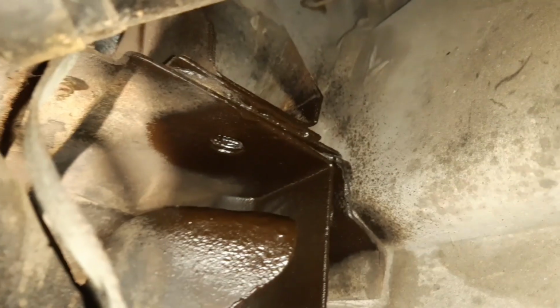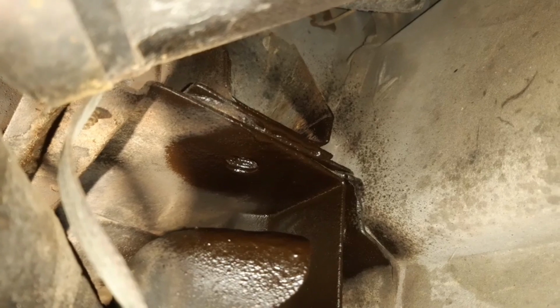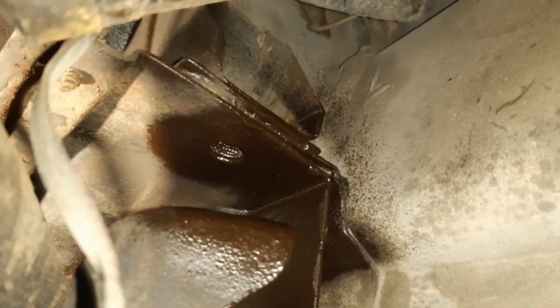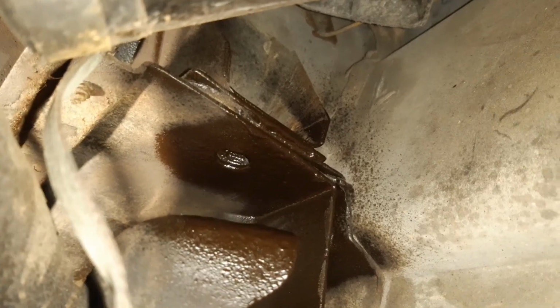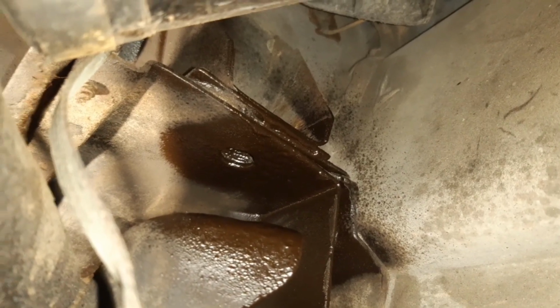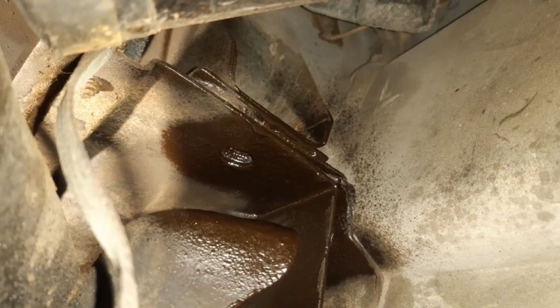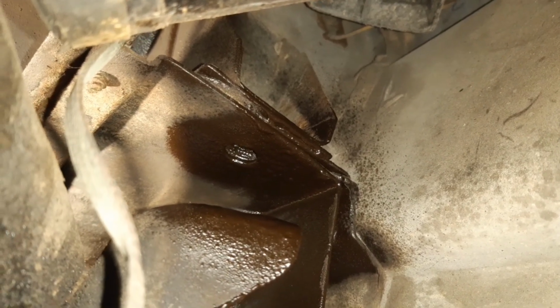And again, just to highlight the difference, the amount I've lifted this up. I've heard you have to lift them like 4 to 6 inches, but this is 2 inches, maybe fractionally more. I've lifted this up just to get these body mounts out, so you don't have to get too carried away with these things if you're looking to do this job. It's not that big a deal.